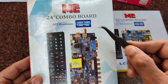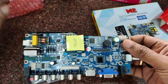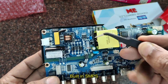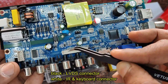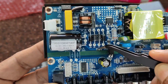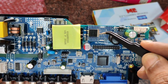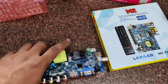The next board is a 24-inch combo board. This also supports HD resolution and has an inbuilt power supply, single USB, and a VGA port. You can directly give AC power to the board. It has a separate SMPS — the yellow one is the SMPS transformer. The SMPS portion is marked as 'hot' and separated by a green mark, so you should be careful while handling this board as the hot portion will have very high voltage. At the back side, the hot portion is covered by a plastic cover for safety.